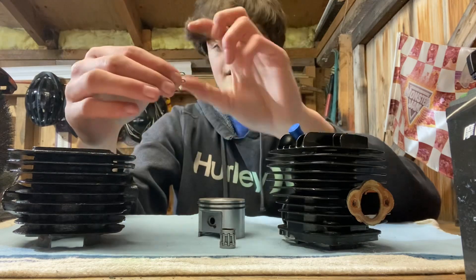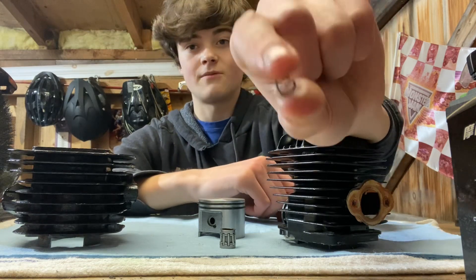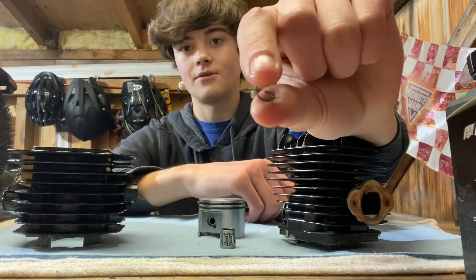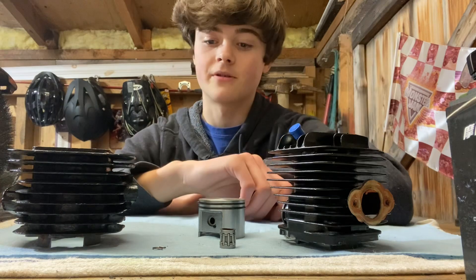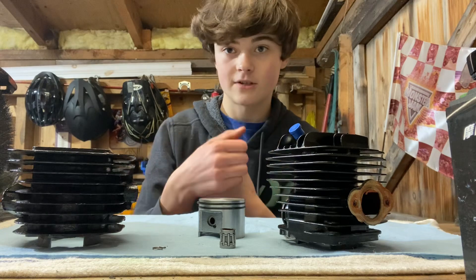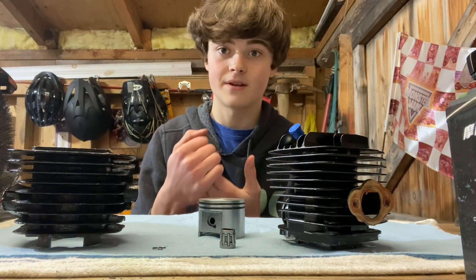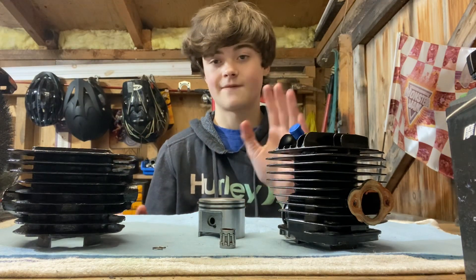Here's another thing: if you have G clips, the G clips are better. These double-ear ones — this is why everybody's YDs blew up — not only were the YDs cheaper material, but these two-ear clips just don't hold in very well. No matter what position you put them in the piston, they tend to fly out and destroy your motor. So here's my recommendation out of all of this: your ring end gap should be 20 thousandths of an inch for a street engine. You should have G clips for your piston, your piston pins need to be facing the intake side, and have the better wrist pin bearing if you can. If you do all that, you're pretty much set up for success as far as the piston goes.